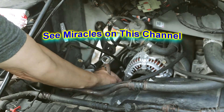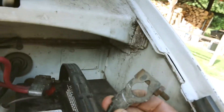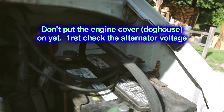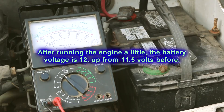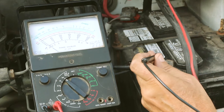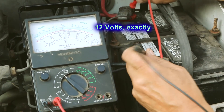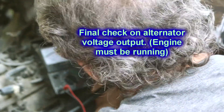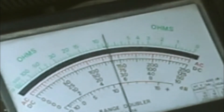Tighten it until the belt's tight. The cable — you want to loosen that before you start, and that's the last thing you put back on after you put it together. This is a half inch. On a 50-volt scale divided by 2, I'm on a 25-volt scale — it should go over almost halfway, which it does. I got 12 volts there exactly. Now I'm reading 13 and a half volts — can you see that? The new alternator is charging correctly.